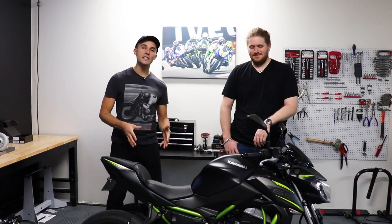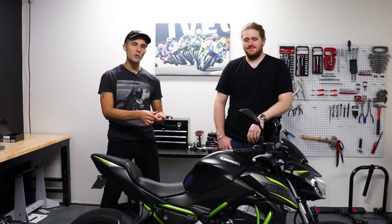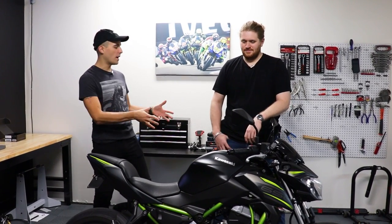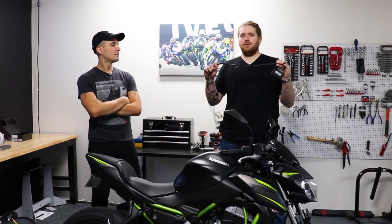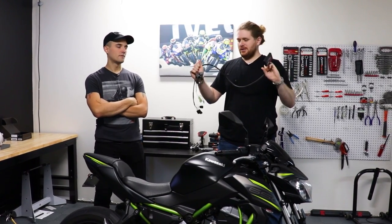Alrighty guys, you know we couldn't leave well enough alone on the Z650 here. We did the full exhaust and we promised you we'd do a fuel controller so that the air to fuel ratio gets all sorted. Spite, what do we have today? So today we've got a Power Commander 5, your fancy dandy piggyback ECU system.